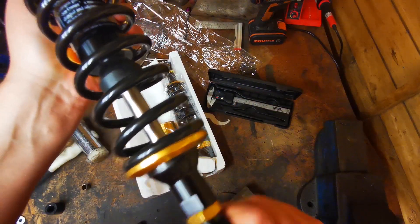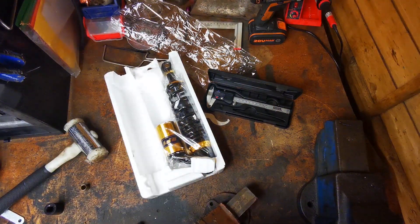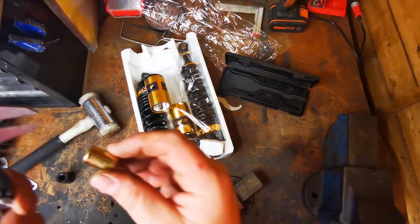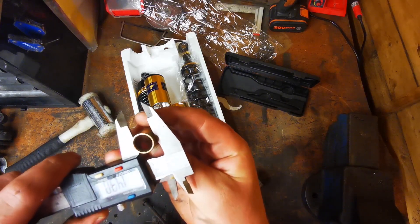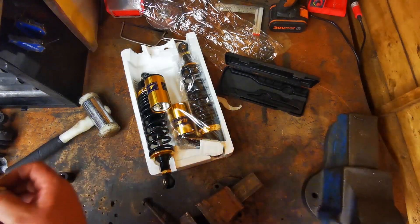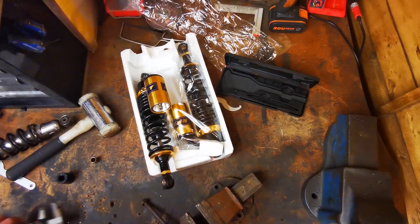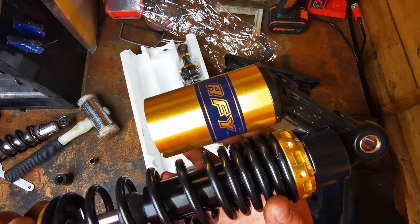So that's my right side bottom mount done. I should check the outside diameter - what's the outside diameter of the new bushing? Just under 15mm. The old one is 18mm. So I've got to wait for my new ones and then we can get them on, but first impressions - yeah, I think I like them.